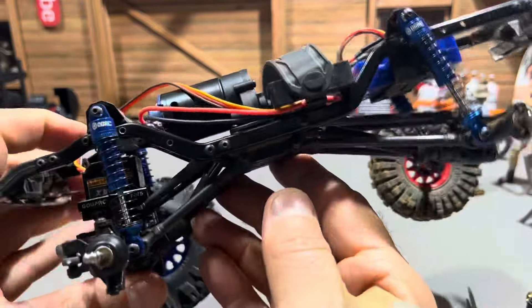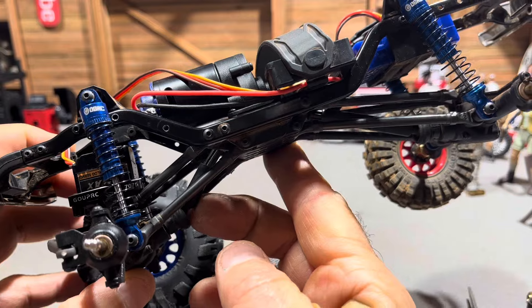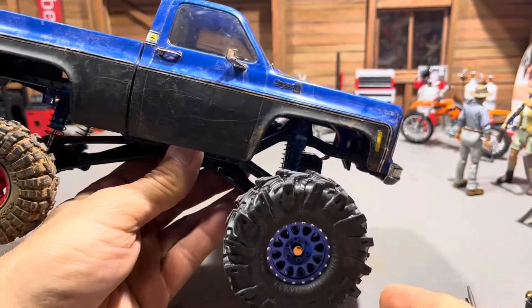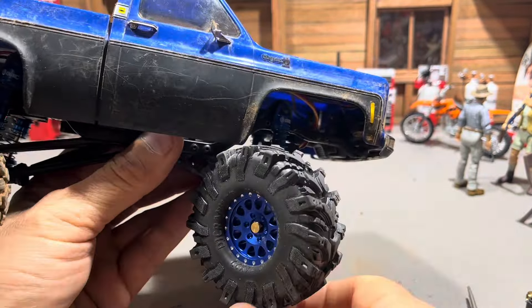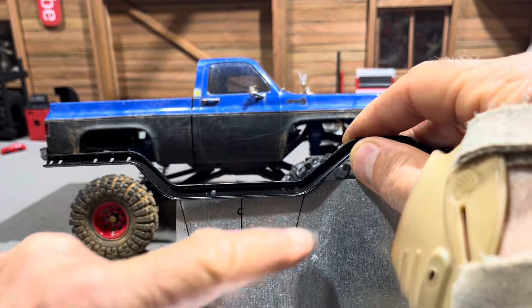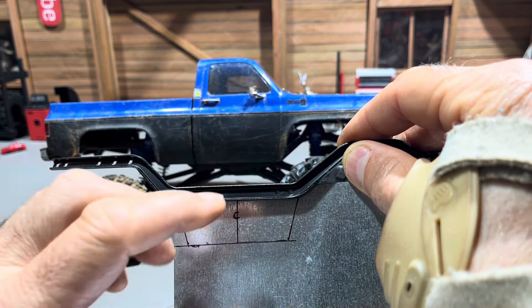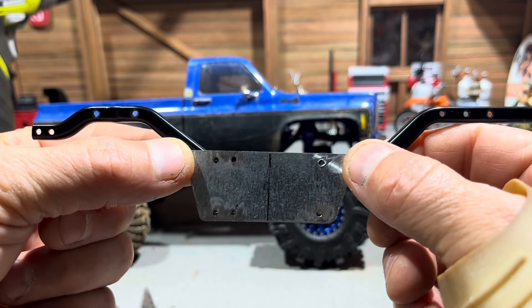I got this mocked up and wanted you to see from a scale point of view just how large these tires are. These are 62 millimeter tires and the front tires are just massive. To get body clearance and make this truck look as huge and cool as I want, I've got to jack this thing up as far as possible — and that is creating problems. The driveshaft is at a massive angle causing binding, and even at the current height I'm still going to get rubbing almost immediately as soon as I start to flex. Also, the farther the suspension drops, the more the axle moves back.